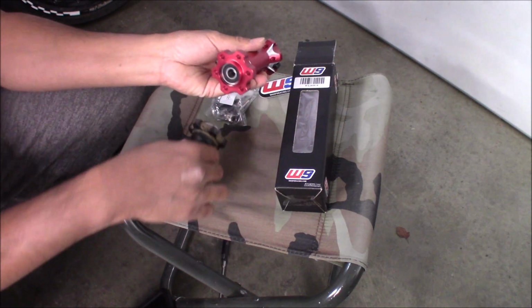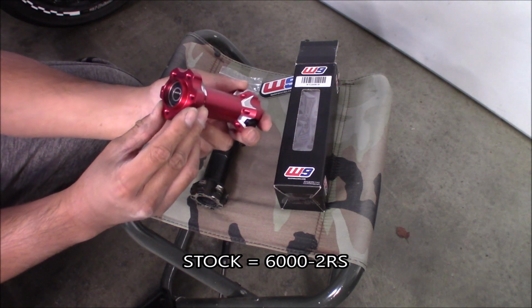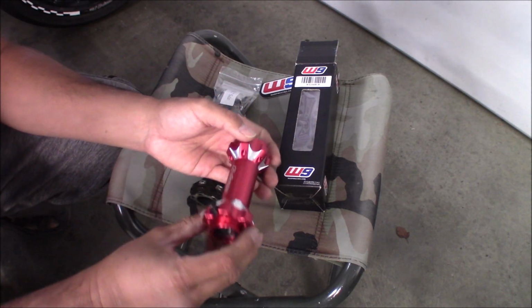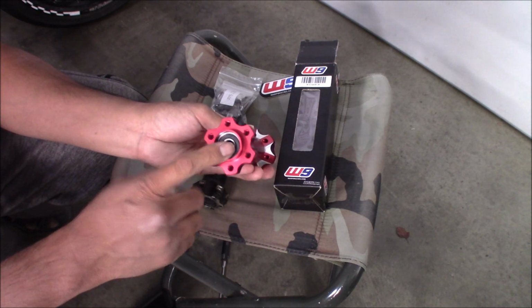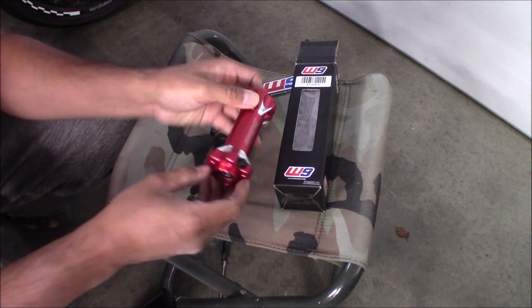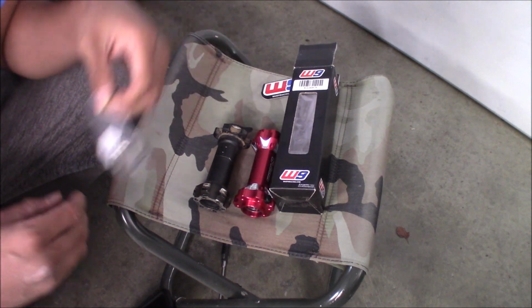Yeah, I think 6000 RS is the... But anyway, yeah. I think you have to use the Warp9 kit for this, okay? But the Warp9 does sell the bearings for it, okay? And like I said, you want the highest quality bearings, because if you grenade these bearings, guys, it will be bad, okay, guys? It'll take your swing arm axle with it, and do all sorts of bad stuff.